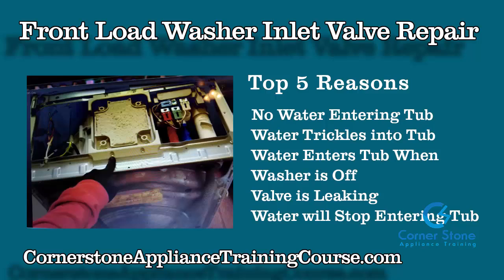Before we get started, let's look at the top 5 reasons why you would need to replace or repair a water inlet valve on a front load washer. Number 1, when you've turned the washer on and selected a wash cycle, no water enters the tub. Number 2, the water is entering the tub, but it's trickling extremely slow. Number 3, the water enters the tub even when the washer is turned off. Number 4, the valve is leaking, and that's usually the main reason you're going to replace a valve. And number 5, the water will not stop entering the tub even though it's reached the cycle that you selected or the desired water level.